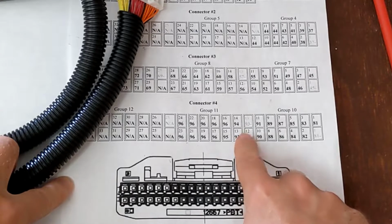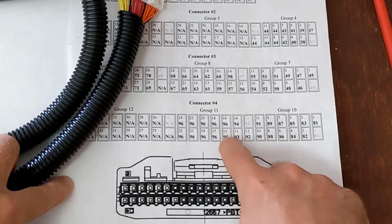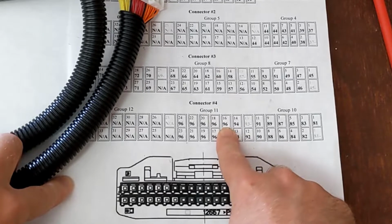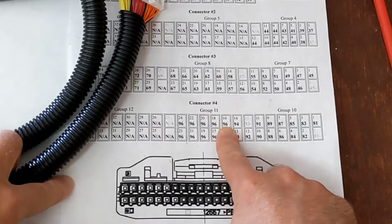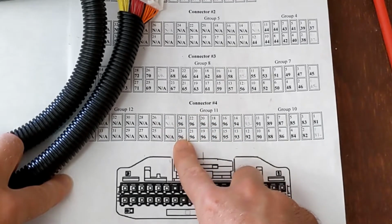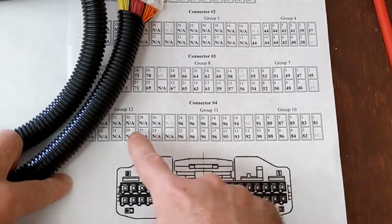And then we roll around here to our negative 13, then our 13th lead. We go to 94, 95, 96. Okay, so that's the last cell of a Chevy Volt pack, right? It's cell number 96. But if you notice, we still have 1, 2, 3, 4, 5, 6, 7, 8 more leads here within the second group of 12. First group of 12, second group, third group.